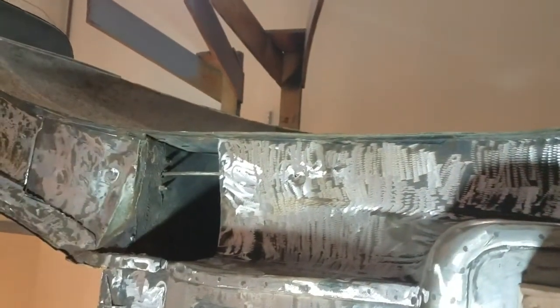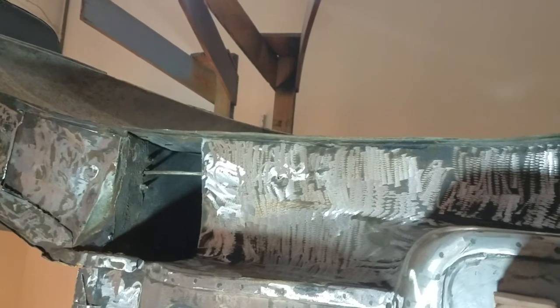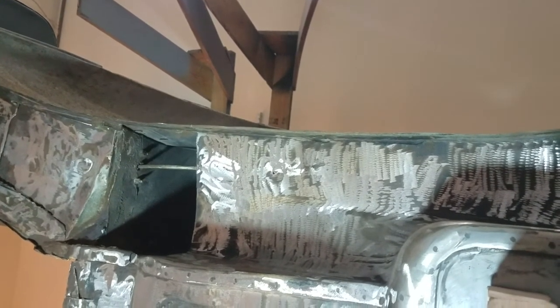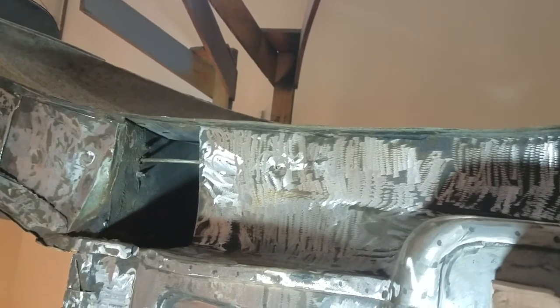This side is done — at least the stripping is. I took another couple hours with a blowtorch and more putty knife, got all the junk off, and I've got some areas I still gotta get done. That'll be a little bit of a bitch, but aside from that, I got all the undercoating off. I even cut the hole where the damage was, so I've gotta replace that and the portion inside the trunk so it looks natural — that won't be too tough.